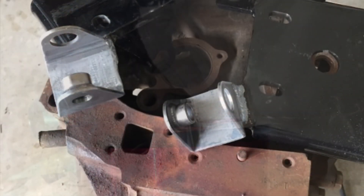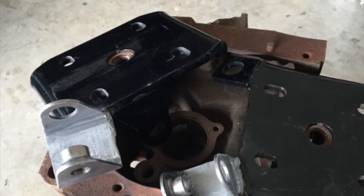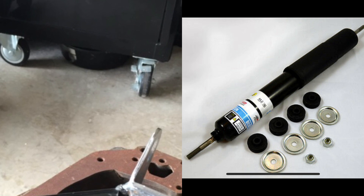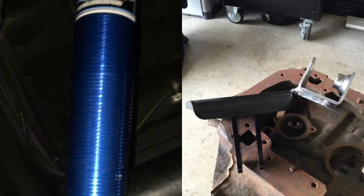I added this section of the video as it may help other people getting their cars ready for the season. I run CalTracks, but with stock Ford shocks that have a pin-type mounting end. Not a lot of shocks are available for that — most are a GM style with a bolt. So I got an AFCO adapter, and I welded it to the bracket on the CalTrack leaf spring mounting plate. You can see there how I welded it on. Worked out awesome.